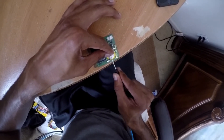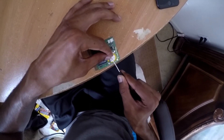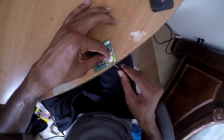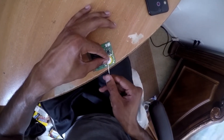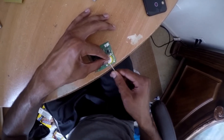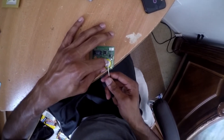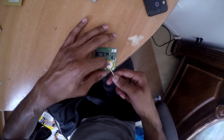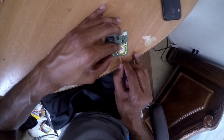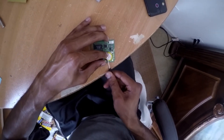I just have one more to work off. Doing this is going to deform the arm a bit, but that's okay. Because if you ever do choose to replace the battery by soldering, the arms come off with it. The batteries you buy have spot-welded arms already on them, and you actually solder from the contact points. But we're just going to do it the quick way today.